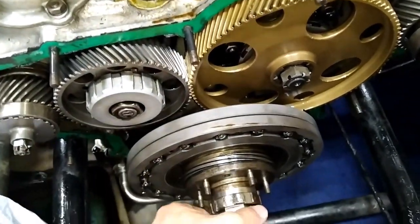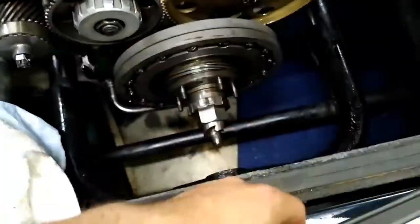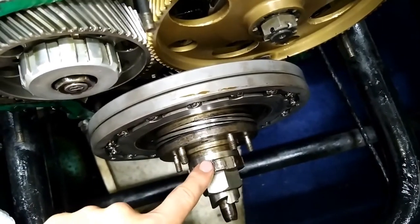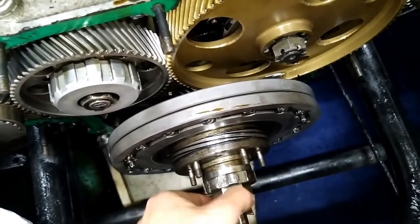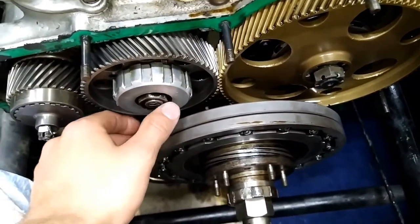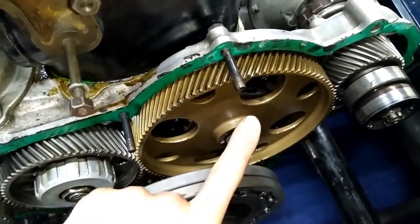First of all, we take this damper off the nose of the crankshaft. You don't need a specialist tool to do this — what you need is a 34mm spanner and a form of chisel or screwdriver and hammer to remove the starting dog captive nut. This is left hand thread, so you knock it that way and completely remove it, then turn the starting dog anti-clockwise. With the covers off and someone spragging the crankshaft from the flywheel, the damper will start to pull itself out. You then remove it completely and look back at the bronze gear.